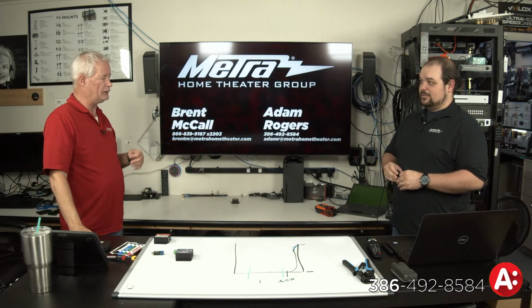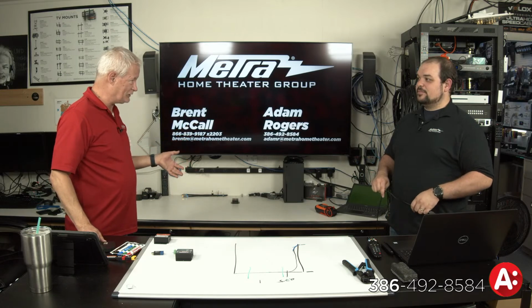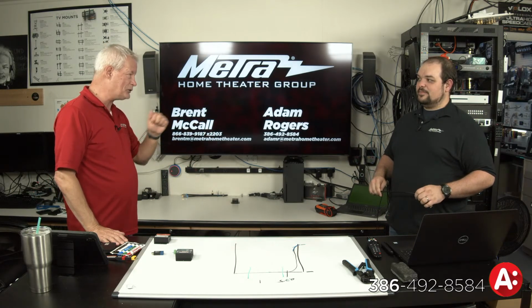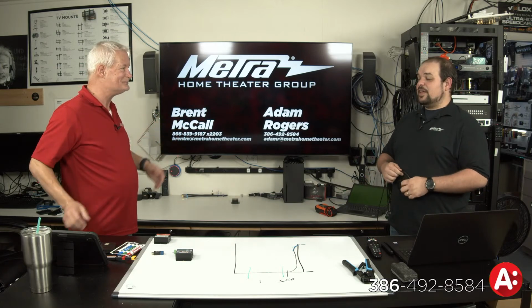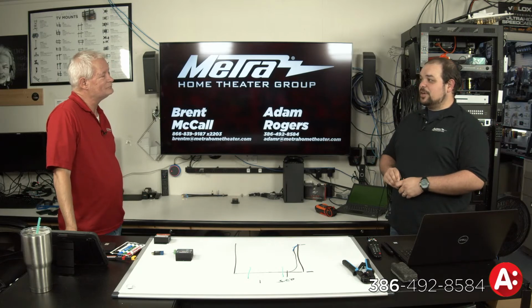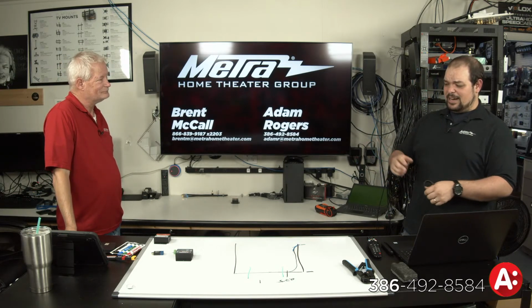I've had guys where they're using the Apple TV for audio distribution. If you don't have a display connected to it to know it's in update mode, or it needs an update, and you have to agree to it, because if you're using it for the AirPlay functionality, it may be asking for an update, and when you try to AirPlay to it, it just doesn't accept the AirPlay signal, or it may not even show up for AirPlay.